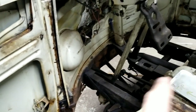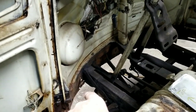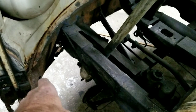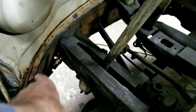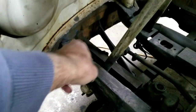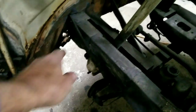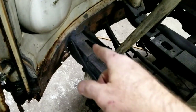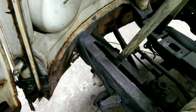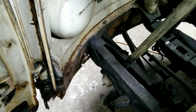There's a lot more work in the front than what you think. Some people go 'oh I just need the front floor' - it's a lot easier to change that outer panel with the floor out. I was trying to tell CT: dude, you need to yank that nose off before you put that floor in, because you need to see what's going on behind there. If yours is like this you may have to change that inner panel. I'll put it in fast motion for the next part - take off that dog leg on the other side, then bring you guys back.